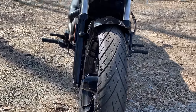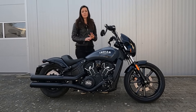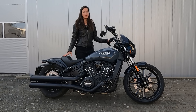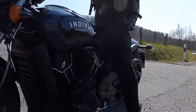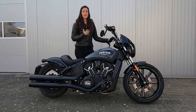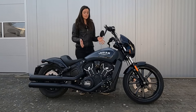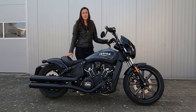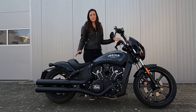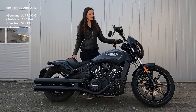The brakes are a single disc front and rear, both 298mm in diameter. Looking at the specs I was skeptical, but they worked out perfectly for this weight class — it always stopped in time with no issues. For a heavier ~400kg bike I'd prefer dual discs, but I understand it's a design choice and for this bike it worked well. The brakes were really good, even when braking lightly mid-corner. In Germany the price is around €15,000 — check the websites in your country for current pricing.